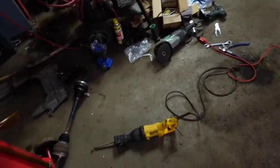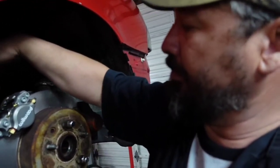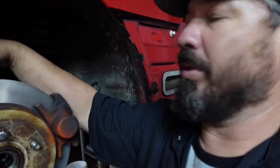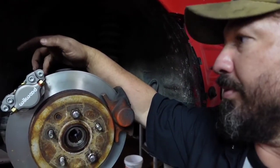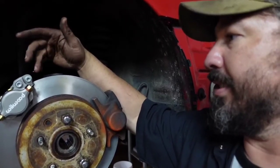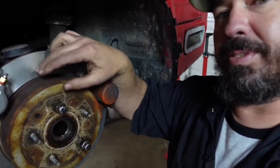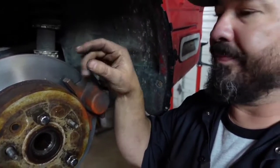If you leave some of these parts in there, it's going to be a pain to even get the brake shoes back on. So I think it's going to be easier to completely do away with the internal e-brake and just use the second caliper as our e-brake. I actually cut that off and discarded it. That piece goes from one of the caliper bolts — it mounts on the back of the caliper with a longer bolt and ties into the e-brake assembly. But the way it's set up is just insane, so I decided to discard the whole internal e-brake setup.